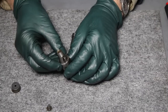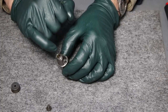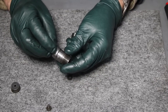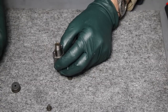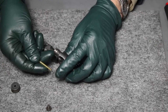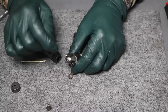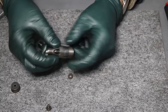We are seeing a number of problems with this upper housing, having a lot to do with what's going on between the inlet right here and the outlet hole right down there. Without being able to cut these apart, you do not know — particularly if these injectors have been running waste vegetable oil, or they've been sitting around a long time collecting rust and crud. We make a little wire brush out of small wire and a brass tube, and we get it down in here to clean out the junk. We supply a small wire to feed through the inlet holes, but even then, there are times we have to reject these upper housings.